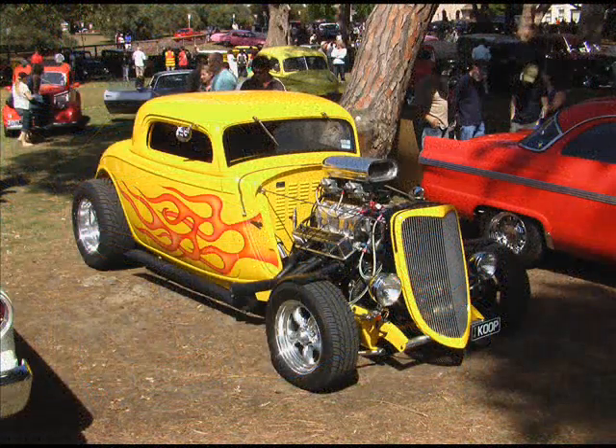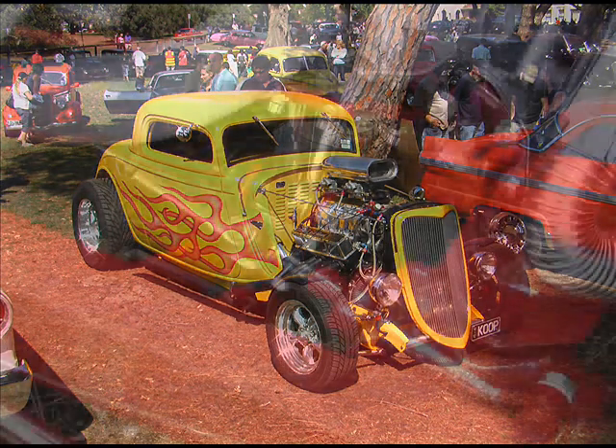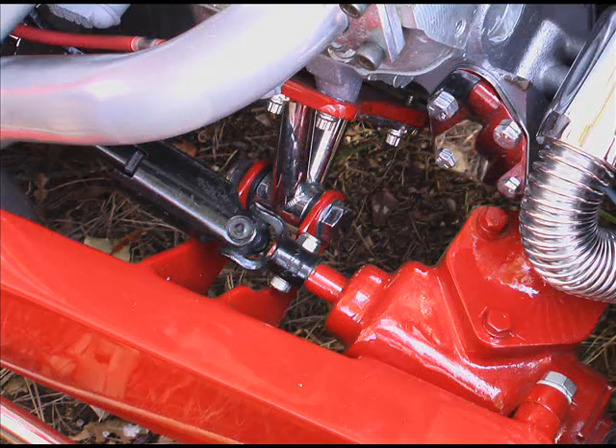When we're running high horsepower, we tend to obviously use our right foot heavier than normal and we don't want our engine mounts to actually snap. If they do, you risk your sump dragging on the ground, spewing all over the road and causing accidents. This version of an engine mount here is typically not well-liked by local authorities. If that bolt was to snap, the engine can drop further and hit the ground.